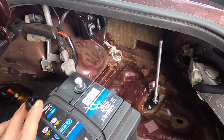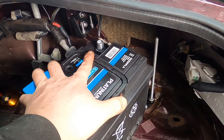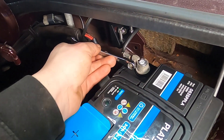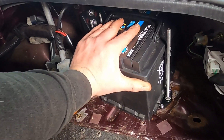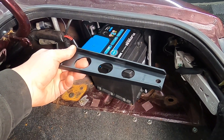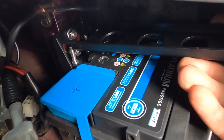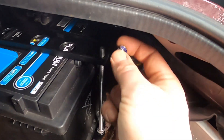With those two parts in place, slide your new battery in just enough to put the negative terminal on and do that up, then slide the battery into its new home. For the tie-down bracket itself, it's installed with the catch facing down against the battery — slide it onto the two bolts at the back first, then onto the big stud, and install the nuts.